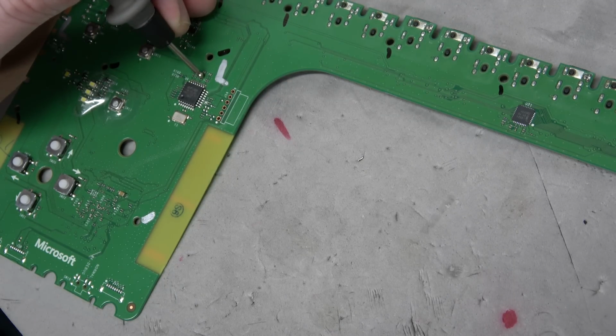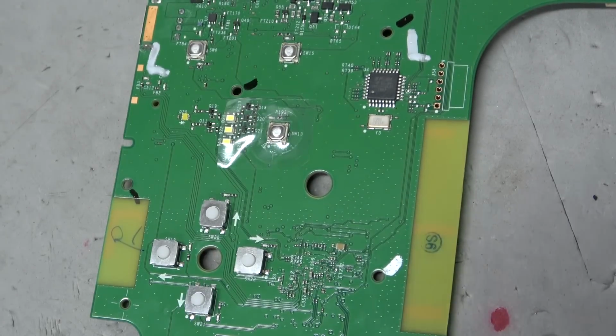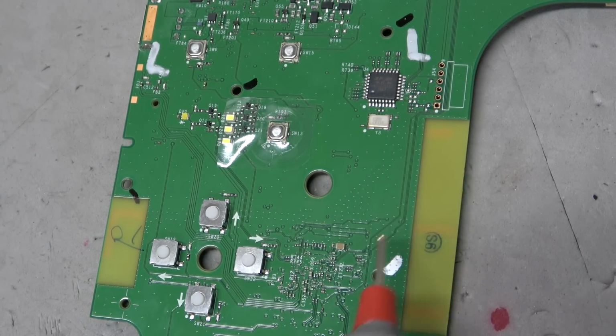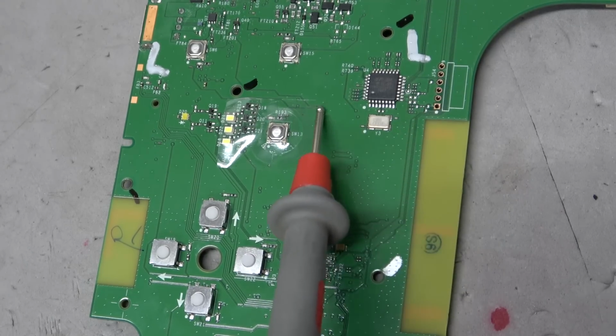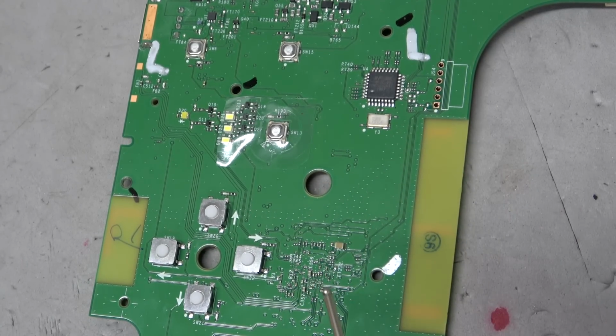All right, so this FTDI chip is acting as a host controller for the 2 USB devices that can be plugged into this controller. I mean, that doesn't really help us with the compatibility issue. If anything, it makes it worse because there isn't a simple way to get analog joystick control into the main system on a chip.